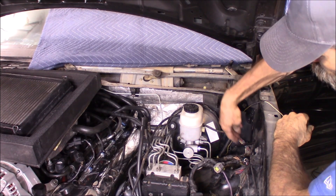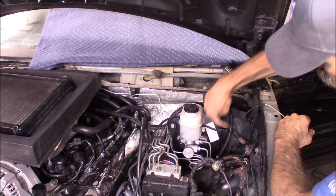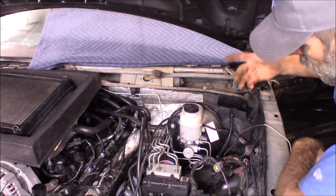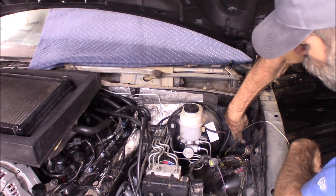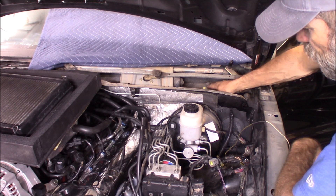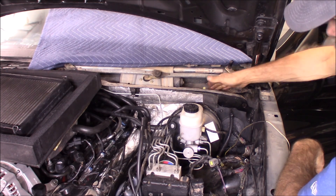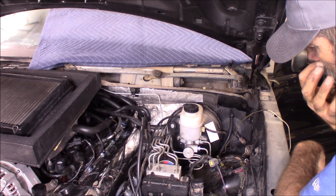Now I've got options. I could use this wiring for the most part, come up into this cavity and head down this channel — that would be the easier way. But if you really want to hide all these wires, we'll do an actual tuck. I'd like to take those wires back into the inside of the cab, drill a hole back into the cab, and then bring those wires up through here into this channel. That's going to be harder, but that's the way I'm going to go.